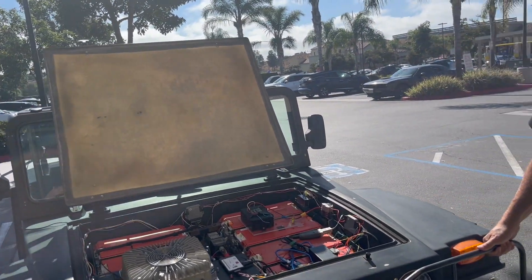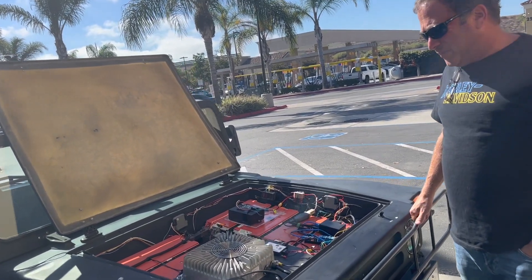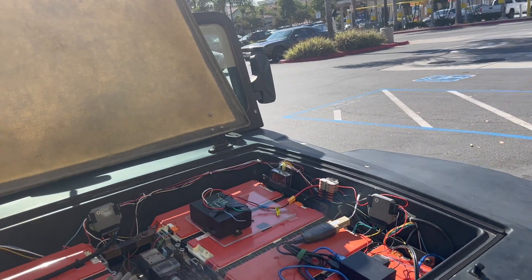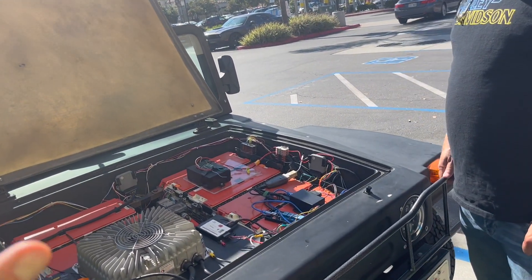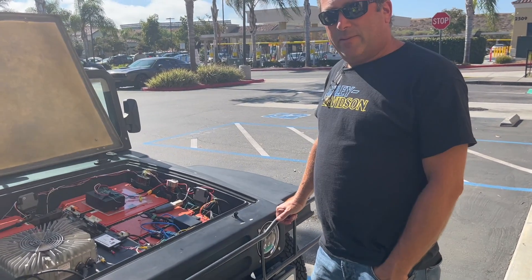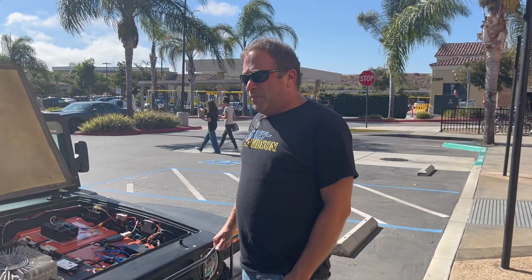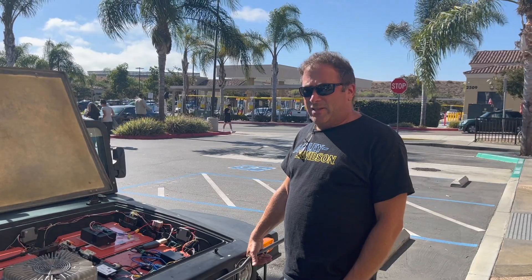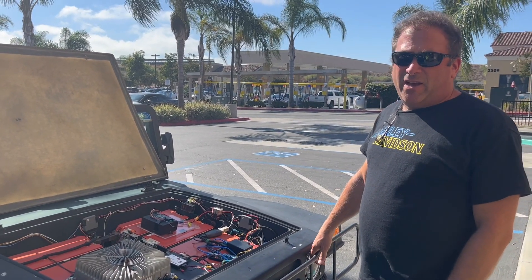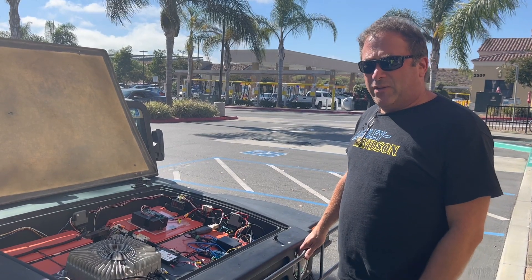Since these are all junkyard batteries, they've been charging and discharging at different rates, and I've been weeding through them to pull the bad ones out. You can go in with a scalpel and swap them out in packs only — they come out with four bolts and I've done it on the side of the road plenty of times. Without a BMS, I've ruined many batteries — eight to ten packs — by over-discharging and over-charging them. Now I stop charging when the top cell hits the top voltage instead of keep plowing power into it and ruining the cells.